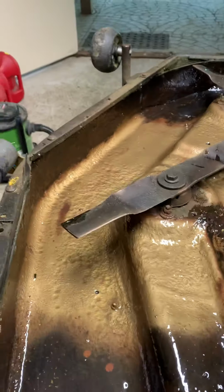So I said, this is crazy. I started getting some areas that were heavily, like where they usually cake up over here and in here, and you could see it's really pitted. I primed it. I started just throwing a can of Rust-Oleum. I had some gold laying around. And then I said to myself, this is crazy. The paint's just gonna come right off. I used the rusty metal primer after I wire brushed it, cleaned it with acetone and everything, and then I threw the primer on.